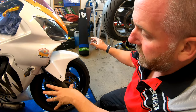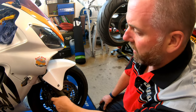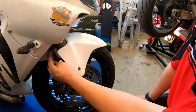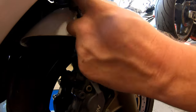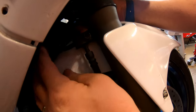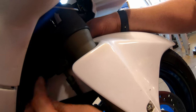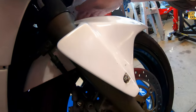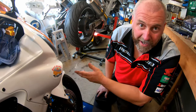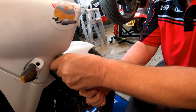I have drained the fluid out of both lines - there will be a little bit of residual fluid left, but we'll deal with that once we crack off the banjo bolts. On the front of the Honda, the lines tend to be quite proprietary. We've got this little block and a hard line which goes over the top to the master cylinder, and then one at the back comes round the mudguard and goes down to the caliper on the other side. You've got one line that goes to this block and then it splits into two. As I said, quite proprietary.